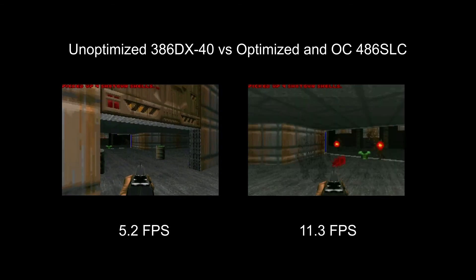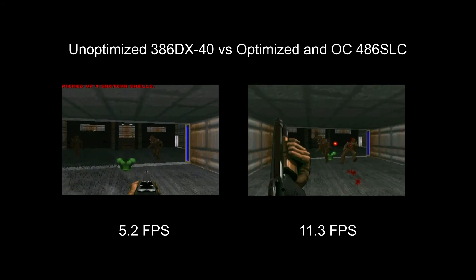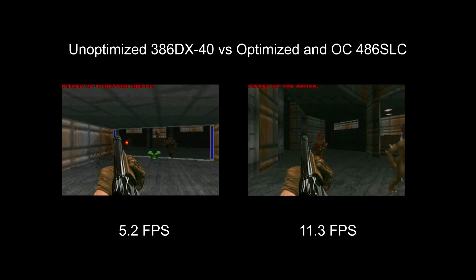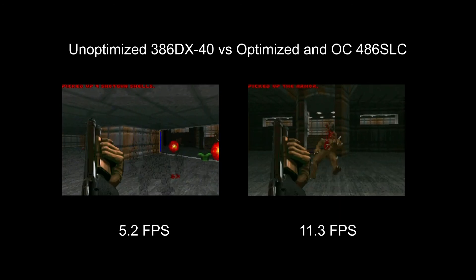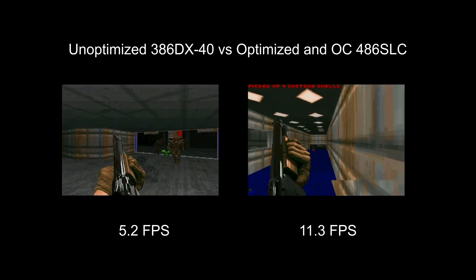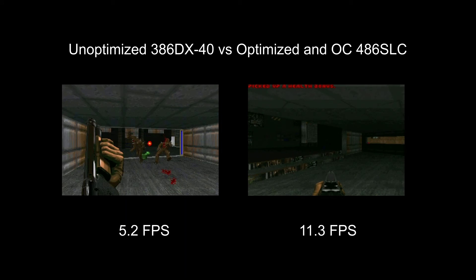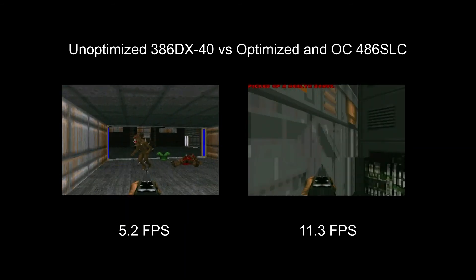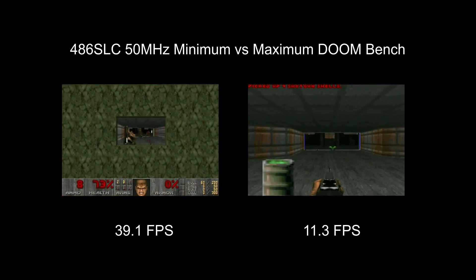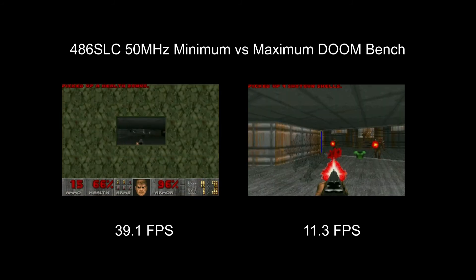The 486 instruction set in the SLC probably doesn't make a big difference across the board unless everything tested here utilizes it. Now, the ability of this processor to do 50MHz when it's labeled 33 has me wondering if it isn't built on the same process as the SLC 250 chip, with just the doubler either missing or disabled. It wasn't uncommon to do this for lesser chips back then — like the early 486SX chips being DX chips with a bad math processor section that was disabled and sold as SX. So it's possible the 50MHz core clock might not be a real overclock if the core was designed to run at 50MHz. I've got a 133MHz oscillator coming that would give me a 66MHz core clock, but I'm not holding my breath — 50MHz is already 25% above the rated speed of this motherboard, and 66MHz would be twice the labeled speed on this processor.